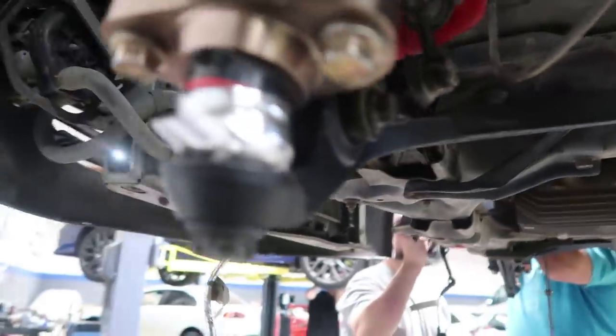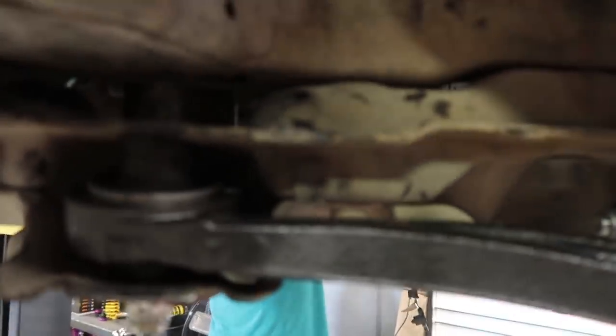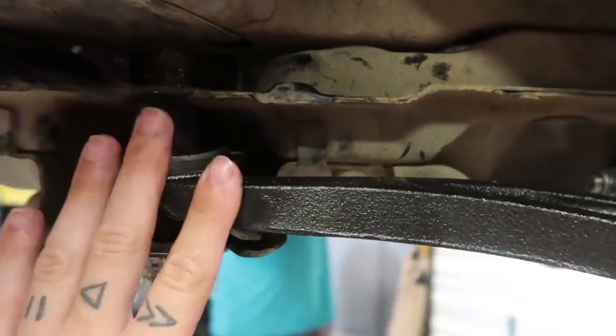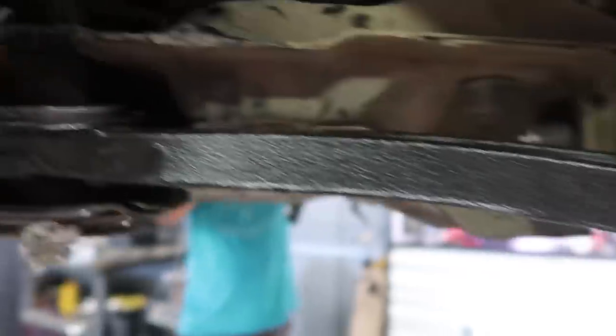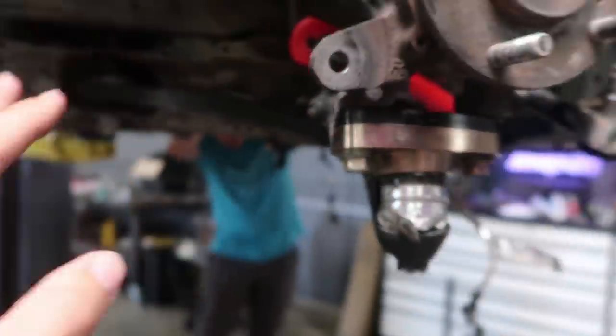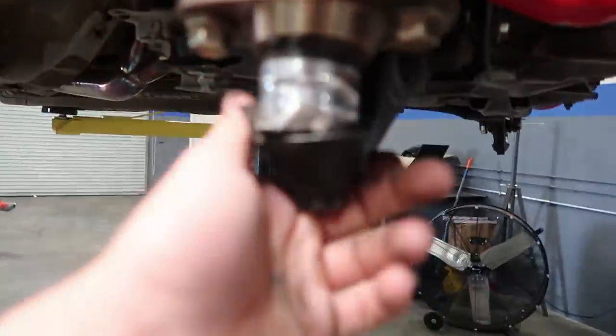Just so you guys can see, the OEM knuckles are back in right here — it looks so much better than the old crusty one. Fresh OEM straight from Honda. I know you'll literally never ever be able to see this when the wheels are on and I'm driving, but these Spoon bushings look so nice and fresh, along with the knuckles and all the new suspension arms. I think it's gonna make a huge difference, especially with feel, just because a lot of bushings were blown out already.